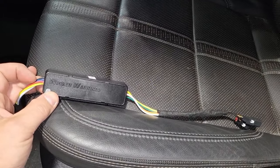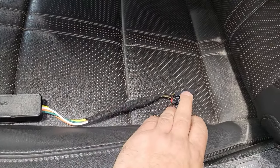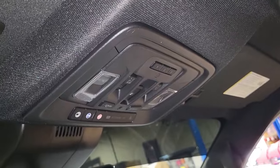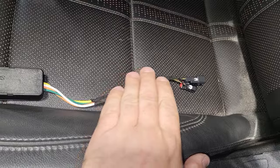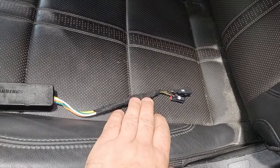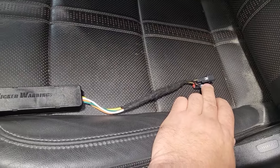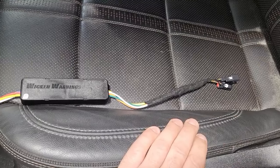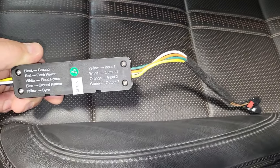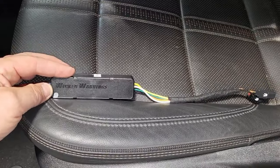The synchronization yellow may or may not be used. Blue will be negative to pattern as always. Red to switch power for flashing and black to ground. The modules are sent with the connector plug and play for the single feed for all three roof lights. If you choose to split this open and isolate the middle roof light, you can untape this and use channel two for the middle roof light. We don't have a connector for the middle roof light included, but the flasher is a two-channel flasher capable of that — you can order the extra Z114 connector on our website. Input output 2 is listed on the back — orange and green, blunt cut, not used by default. Default uses yellow and white for input output 1.